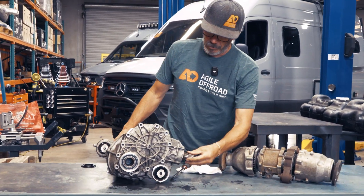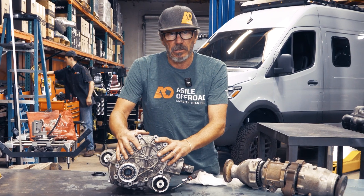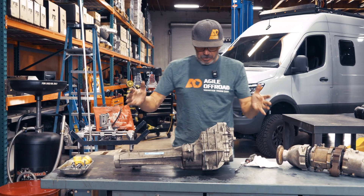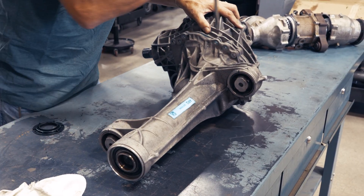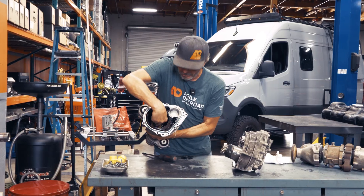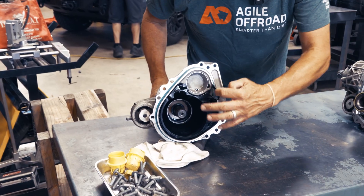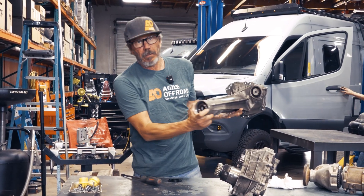The input going from the drivetrain is still on the driver's side, but now we're going to see this bigger part here where we'd assume the ring and pinion is. There's still a bevel gear in there, very similar to the four-wheel drive where it transferred into a planetary gear — this one transfers into a helical gear. This is the driver's side, this is the passenger's side. We've had this apart; they do not come apart this easy. This part here has the axle for the passenger side fixed to it. This acts like a shield for keeping the oil in here, and it looks like there are things for catching the oil and dripping it down onto the gear. It appears to have a bearing here and a bearing in here.